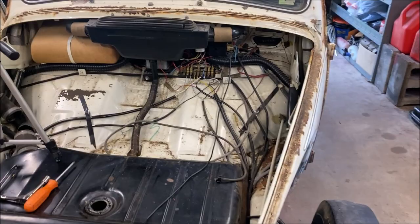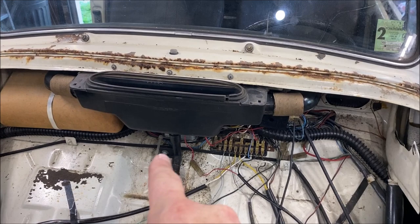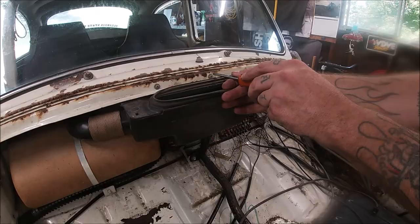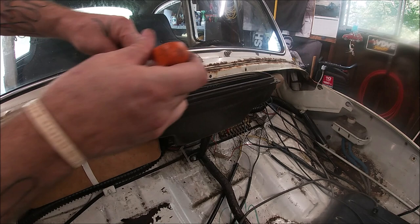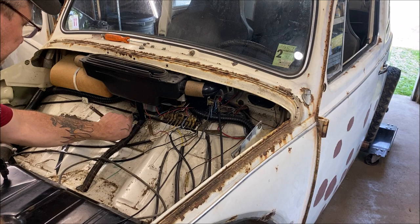What we have to do next — we are under the trunk. My trunk's off, so it makes it a little easier. We're going to take three Phillips screws loose and a 10 millimeter bolt and pull the fresh air box out of the way. Try to keep your screws all somewhat organized. While this is all apart, take your time and clean this fresh air box out, because there will be debris, dust, and dirt. That's a good idea.